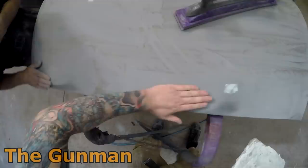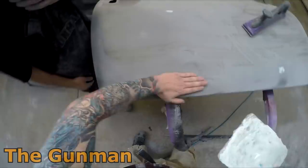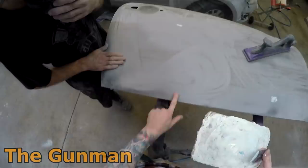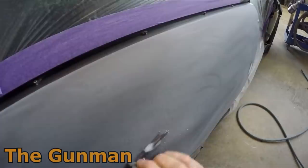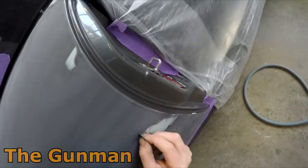On this panel you can see those low spots where the guide coat didn't sand out. I gave Alan instructions to put a bit of two-pack knifing putty into those spots, allow it to dry, then sand it back, and put a little bit of 1K primer over the top — you don't usually get too many pinholes in fine filler. Then I said I'd wet-on-wet or non-sanding prime/seal the entire panel. The end result was great.